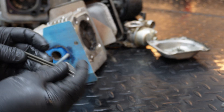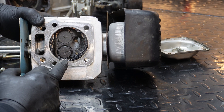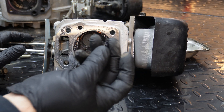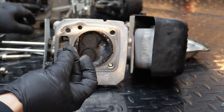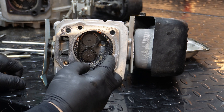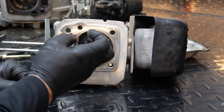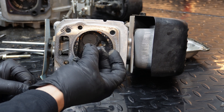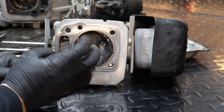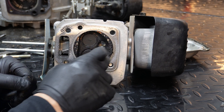Alright, we're getting the push rods out, and these look fine, but let me show you what's happening here. As you can see, there is a ton of carbon buildup on this thing — I can literally just flake that off. All this carbon is what builds up and scratches the sides of your cylinder wall. This is why it's important to change your air filters and fuel filters, and not allow dirt inside the engine. This carbon literally feels like sandpaper, and with the valves going up and down super fast, they'll just chew their way through the valve seats and damage your cylinder wall.